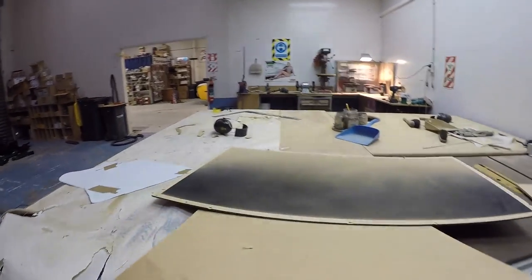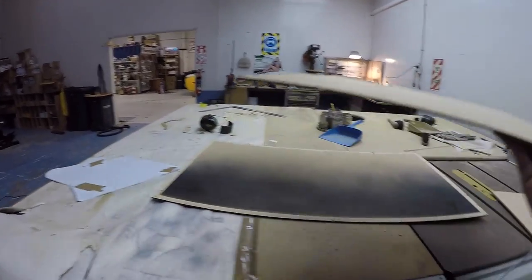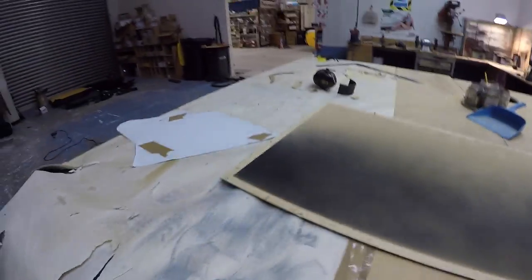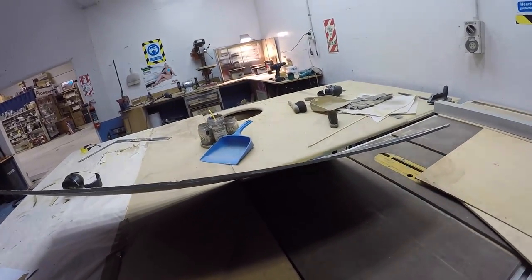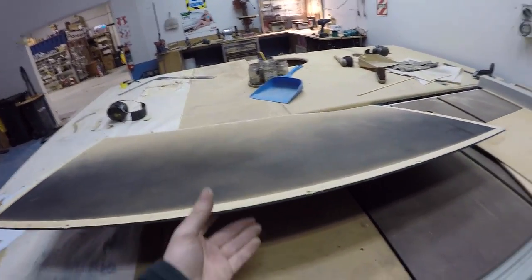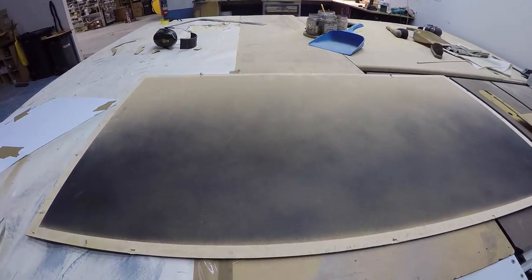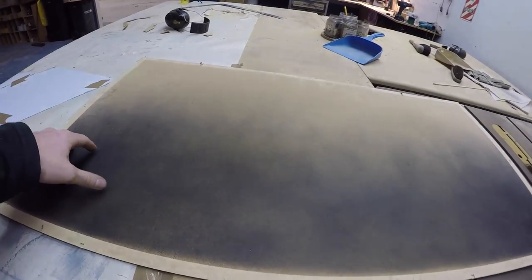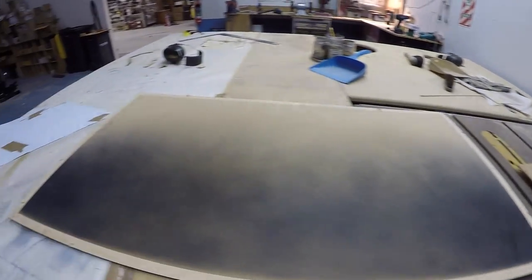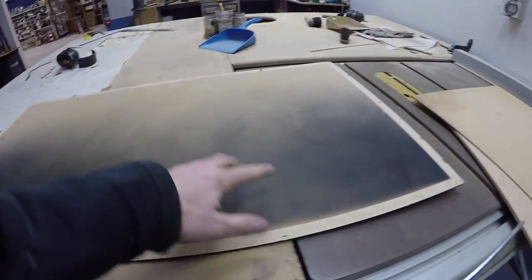I've got this piece here, which is nice, but it's only like 4mm thick. It's a wee bit flexy. But then there's this piece here, which I think is 6mm, and this is ideal, but you can see the problem already. It's got a curve in it. It was actually off a comparator that has been dismantled. I'm thinking I'll still use it though. I'll see if the curve becomes an issue. It's only a very slight one, and the RTV would be able to hold it flat without any trouble. It's just, how do I get it to set with this held correctly in place?